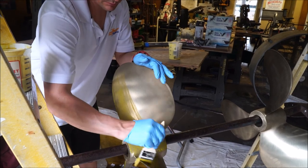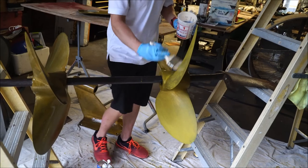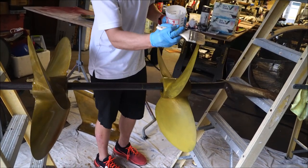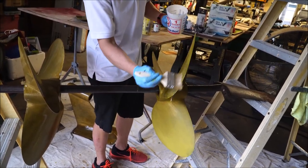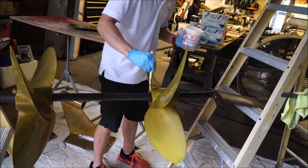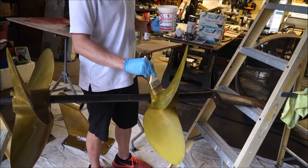We'll show you how it comes out when we're done. Put two coats of the primer base on. Now we're finishing up with the top coat. Remember, the top coat needs to be put on between 5 to 15 minutes after the last coat you've done, no matter if it's just a single coat or two coats. So we're going to finish this up and that'll be it. Thanks for watching.